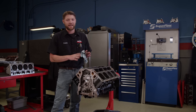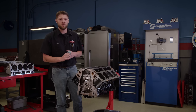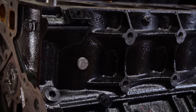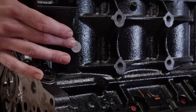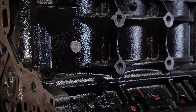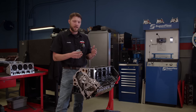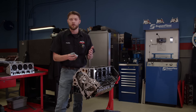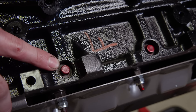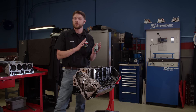It's pretty clear this engine hasn't had a lot of miles on it yet. If you're trying to determine if it's a remanufactured engine without tearing it down, a pretty easy way to figure that out is by looking at the cylinder case or cylinder head for a heat tab. This heat tab is placed there by the rebuilders or remanufacturers when the engine leaves, so that if it ever returns for warranty work, they can see if the engine has been overheated. Another clear indicator of a remanufactured engine is that a lot of the exterior bolts will be painted — things like main bolts, timing cover bolts — all will have a unique color on them.